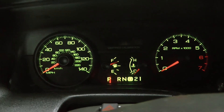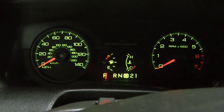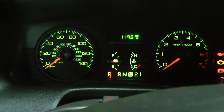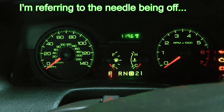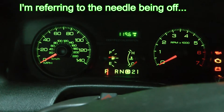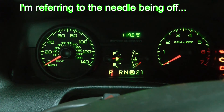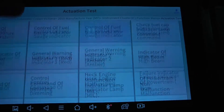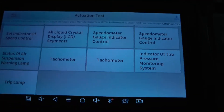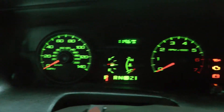I'm bumping up the fuel gauge to show different amounts — so that's full. If your gauge was reading off, you could change it and get it corrected. There are a whole bunch of different actuation tests on here. You could also possibly use some of these to get your needles lined up so that they show the correct zero.